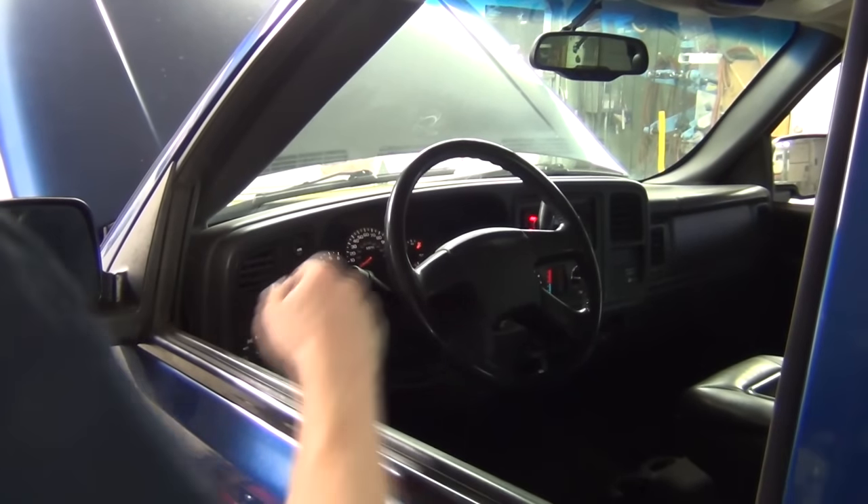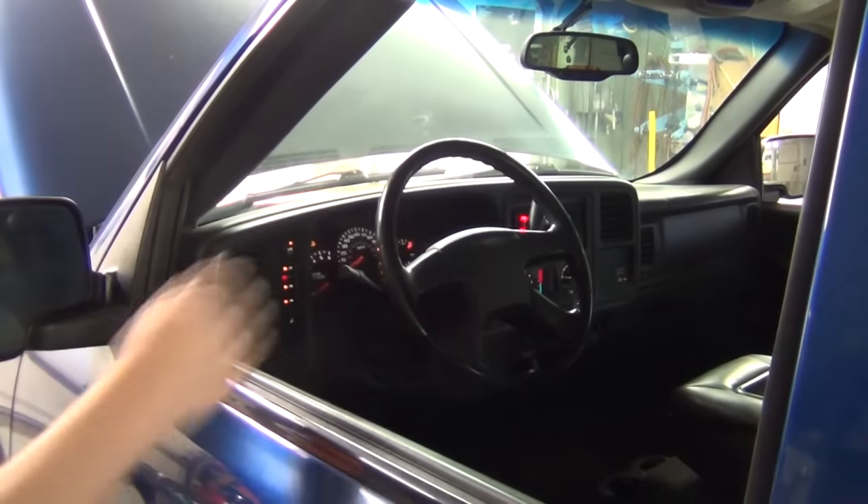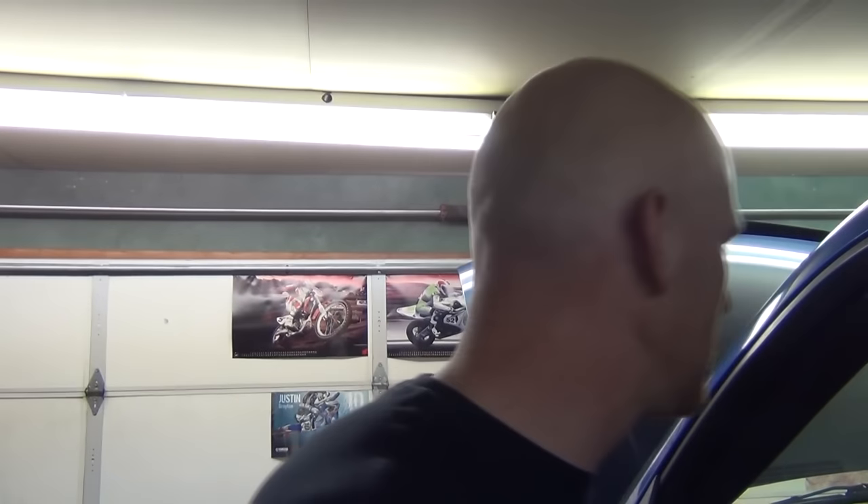I put the new Airtex fuel pump in this about two years ago — I did a video on it back in September 2011. It starts up and runs out of gas. You can hear the fuel pump; it sounds terrible. And it's only like 5 PSI — I did a fuel pressure test on it. So I replaced the fuel filter just to be thorough, because that's a maintenance item you're supposed to do every two years anyway. And sure enough, it's the fuel pump. So I told myself: next time you get a chance, do the fuel pump using the tilt bed method. Tilt bed method? That sounds exciting. So that's what we're doing today.